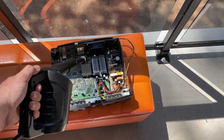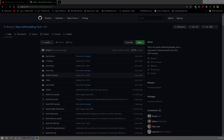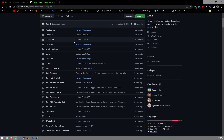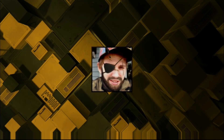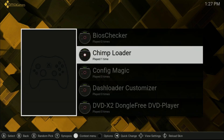After successfully disassembling and correcting 15-plus years of wear on an original Xbox, where does one go from there? Well, it all depends on what you expect to get out of it, but at bare minimum I recommend everyone who intends to keep their OGX running long-term to install a soft mod. The original reason for that is simple: without that soft mod, you won't be able to download your master key from your hard drive and be able to replace it in the future when it inevitably dies.